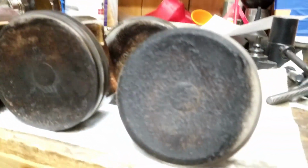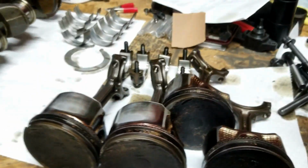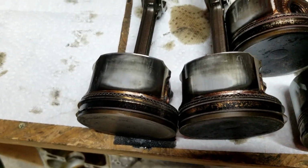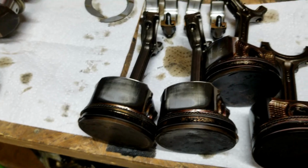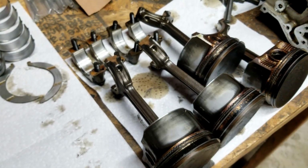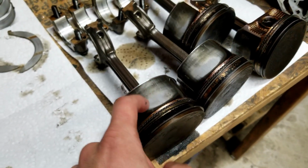As with any engine, the pistons have a decent bit of carbon buildup. The fourth cylinder more than any. And they've got pretty normal skirt wear. This engine has a pretty low rod ratio, so a lot of skirt wear on these. You know, 100 millimeter stroke and 144 millimeter rod. The bottom of that rod is flying all over the place,